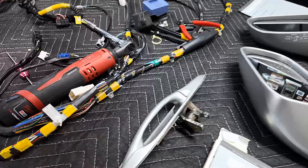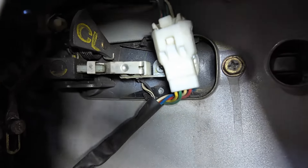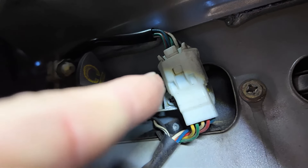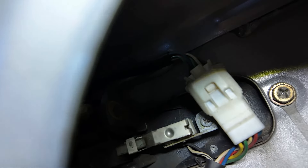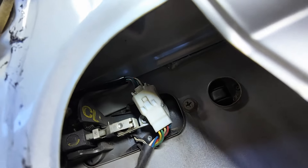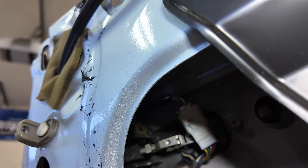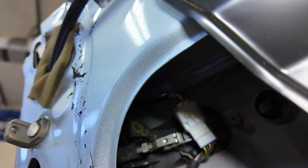For the driver's side door handle it is a little different - we've got to get this off here. We gotta see if I can get my finger there - that's got to be unclipped first, and this has this little actuator here. There's a little screw right there - you've got to take that out after we unbolt this and then this comes off. So you don't worry about breaking it. It's like a little M4 or M5 screw but you do have to unclip that.